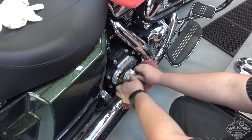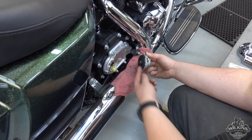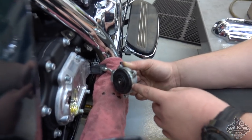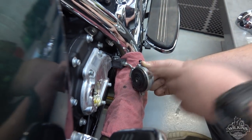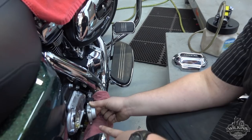It's going to pull right off. A little bit of transmission fluid is going to leak out — that's not an issue. Here's the old one. What Harley-Davidson found was DOT 4 was leaking out through here and onto your bore, and that was causing problems. So we're going to replace it with a new one and then bolt it back together.